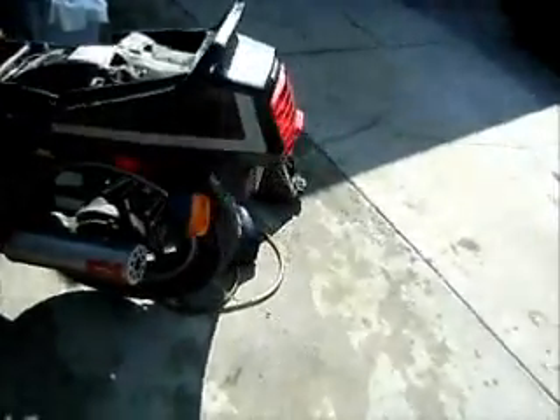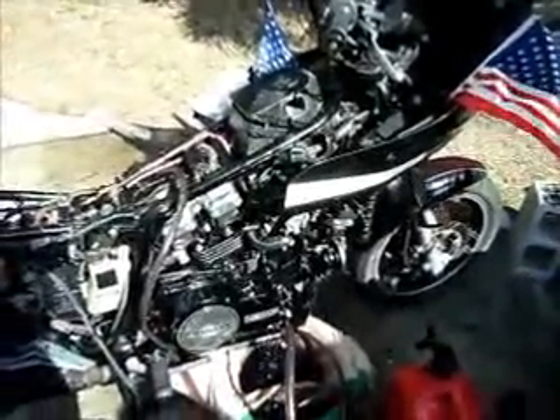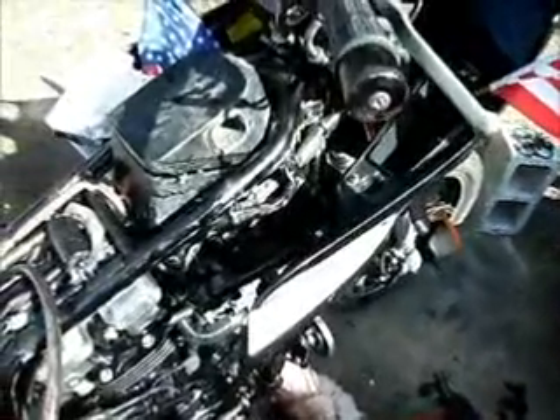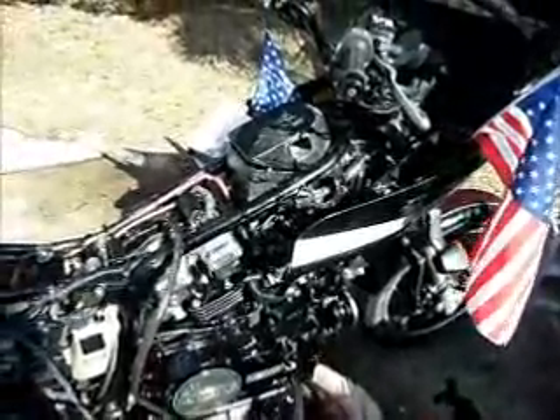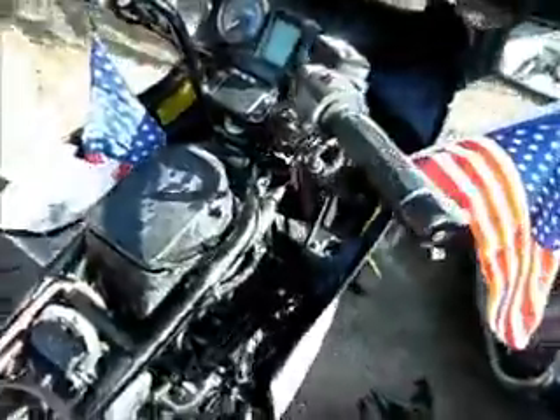This final drive I'm going to pull off of here. I'm going to put one on from a '77 Goldwing — go to 3.1 to 1 for a rear ratio instead of 3.8 to 1, which is where it's at now. That'll bring the top speed up. I've got a little Paxton supercharger and a fuel injection system from an interceptor that drives off the timing chain. I'm going to put in an extended timing chain — this thing's going to get a supercharger and the injection top, which will put the fuel injector sitting right up where the stock air box is. I'm going to run it about twice until it blows and hopefully come home with another bike in the process.